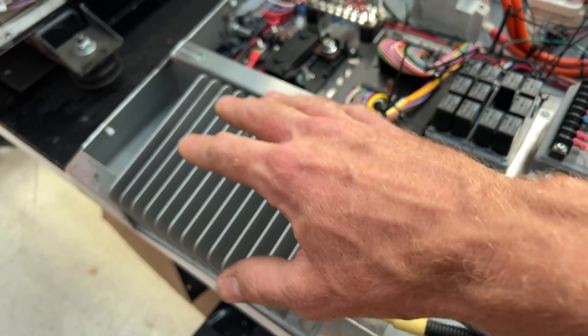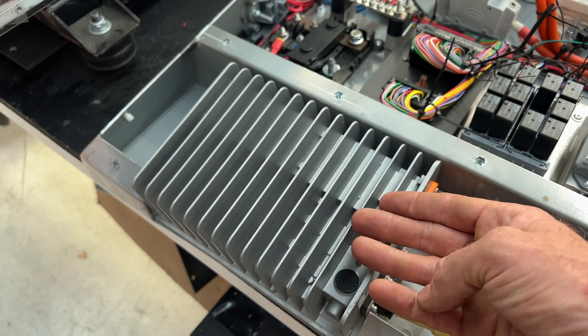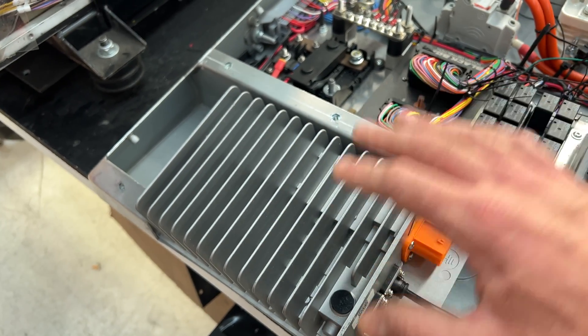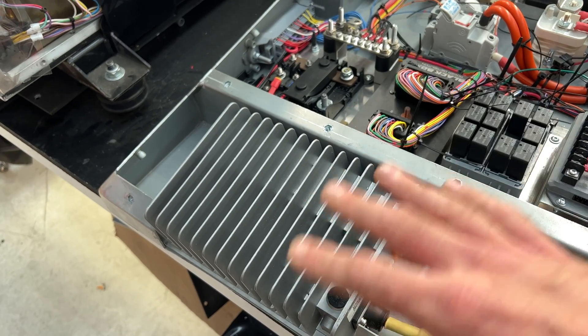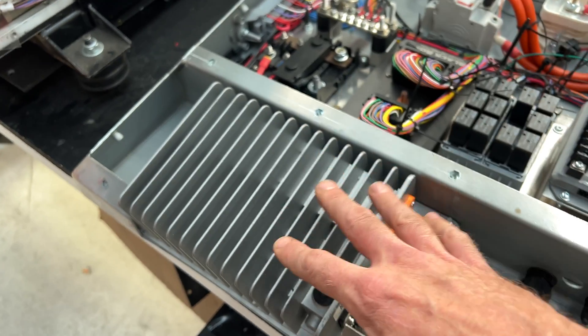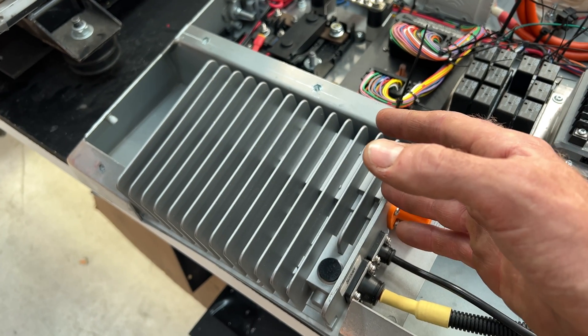So this runs when the car's charging. However, it's air-cooled, and if it's very hot and the car is charging in the sun, the temperatures start to rise. They don't get to anything critical — there are temperature probes and monitors in this that look after that — but it does make more heat than we'd like. And having this constantly run when the battery's already full is just not great for the battery.